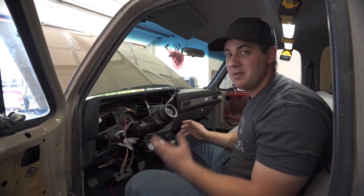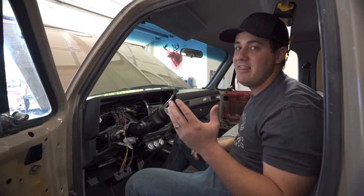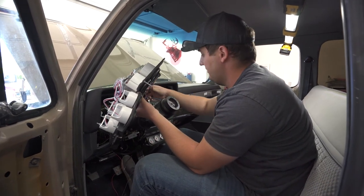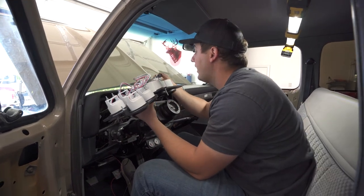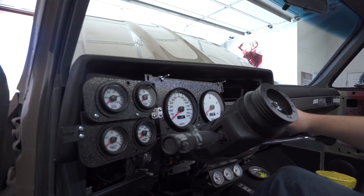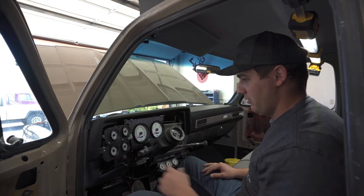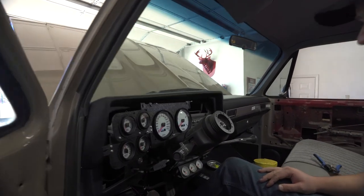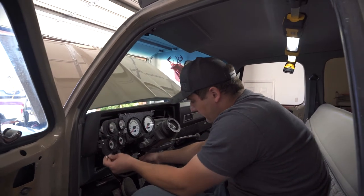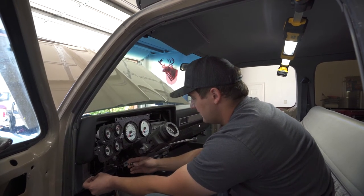If you left your wires long enough, you should easily be able to get in here and mess with it. Our tach side is on the right, speedo side on the left. Not bolting anything down — just want to see that they work. We've got power and we've got ground, they came on, all of them work. We've got some needle sweep — that's the most important part. Our fuel sender's coming up, which is a great sign that our fuel float in our tank isn't bad. We've got battery voltage, that's working. Our oil pressure and water temperature should both read zero because the truck is off, but surprisingly everything's working. We can also test our dip switches by touching them to the dash — they work.